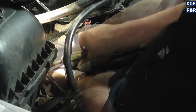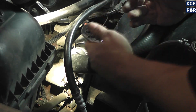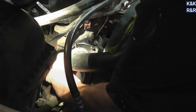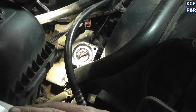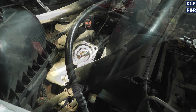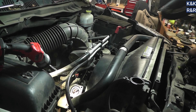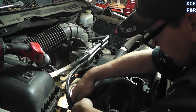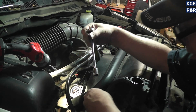You need a self-adjusting monkey wrench, a plumber's pipe wrench, and a small solid extension. You're going to come in underneath the vehicle and pin the pulley so it doesn't move — that's very important, it doesn't move. Then get yourself a pipe wrench on the nut and pop it off toward the driver's side. You're tightening toward the passenger's side; removal is from the driver's side. Then removal from there. You've got to pin it, this doesn't move, and pop it through the driver's side — you can see which way the nut is moving.